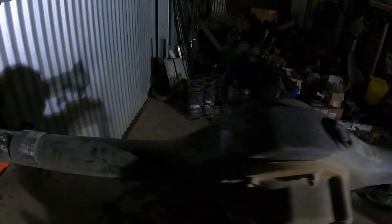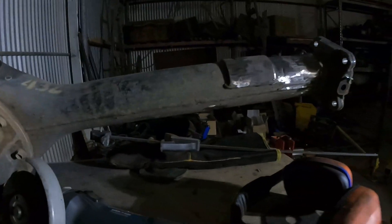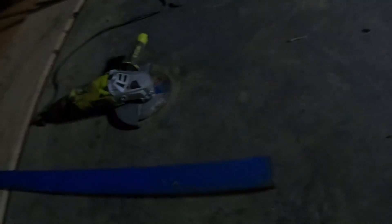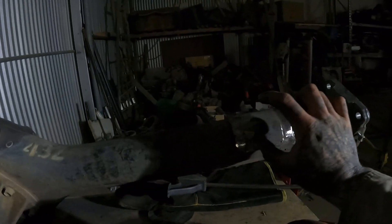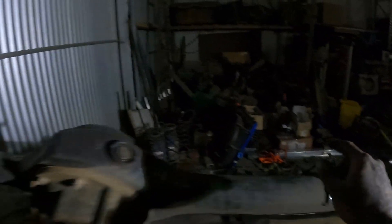So everything's ground up, there's nothing left on this axle now. What I'm going to do first is do this bit of bracing. I've got this 75x50 — I think it's 4mm RHS. I'm going to put a bit of RHS bracing across there on the bottom, and then just strengthen it up a bit, hopefully I don't bend it.